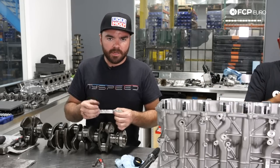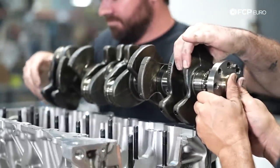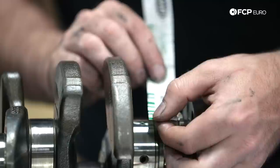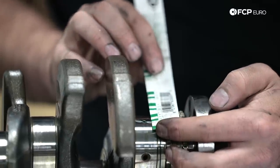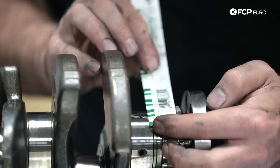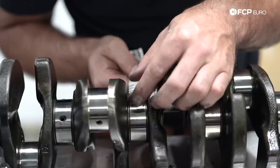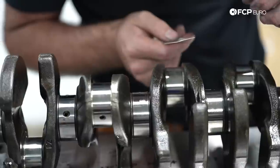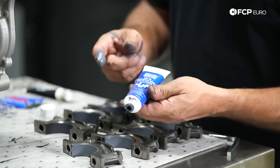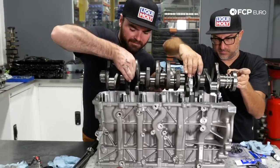After installing and torquing the crankshaft then removing it, we use the plastigauge measuring scale up close. We line it up and can see the line is basically as thick as the 2 thousandths marking, and this measurement is consistent through all of the journals we measured — the majority of clearances are at 2 thousandths. We're good to go. Michael is lubricating the bearings with Liqui-Moly engine assembly paste, then we'll put the crankshaft in, tighten everything up, flip it over on the stand, and install the pistons and rods.